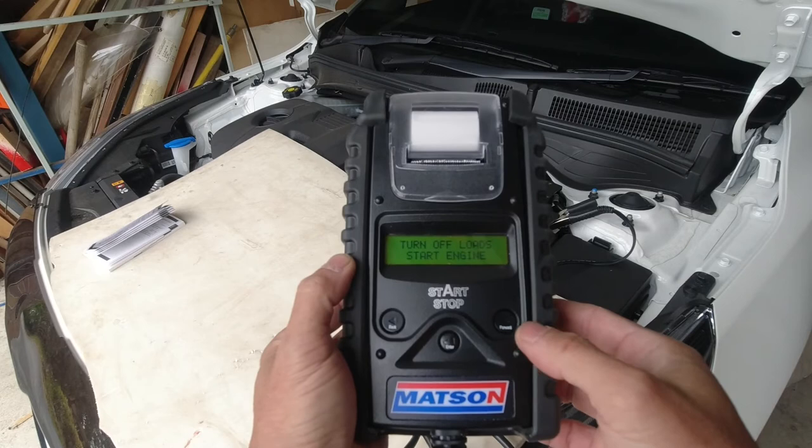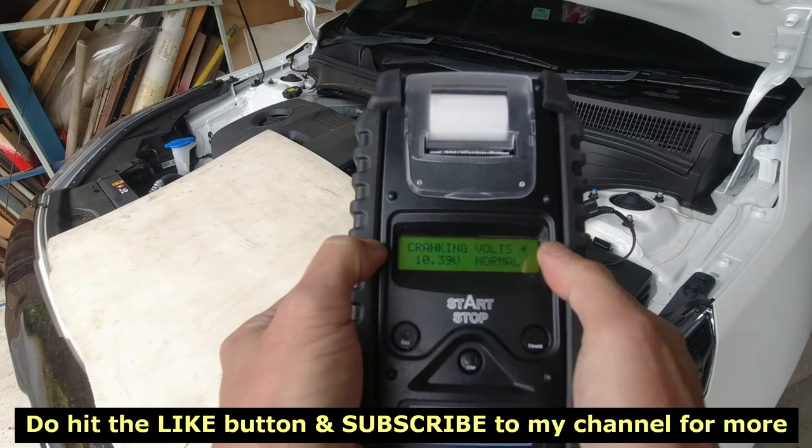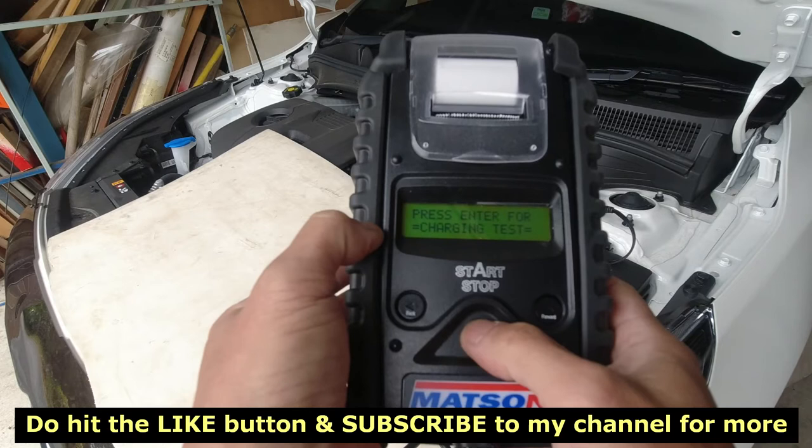Now as you can tell, the engine is now running and the meter shows cranking volts, 10.34 volts, and that's normal, so that's good. I'll press enter to proceed. It says press enter for charging test. I'll press enter again. It tells me to make sure all loads are off.